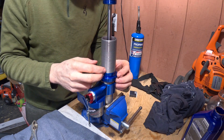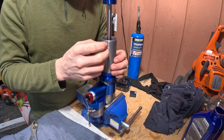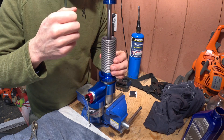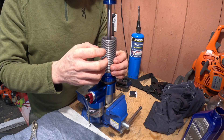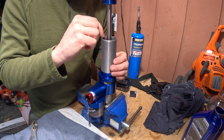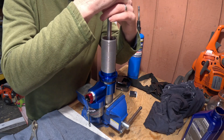I also don't want to go too crazy on this. Doing it real fast is going to create a bunch of smaller bubbles in the oil, making it more difficult for them to rise up to the top. I'm going to just do some slow motions to get as many bubbles out as I can. Then we're going to do some hits with a mallet to break loose any smaller bubbles. Just remember, we're trying to bring all the air to the top — if you push down and then pull right back up, you're just sucking those bubbles straight back below the piston. Nice slow motions to start with.